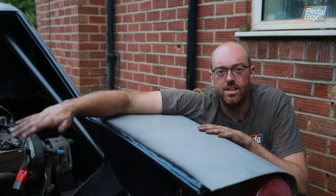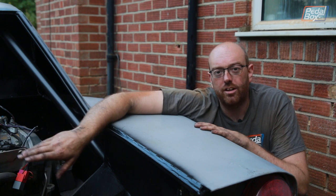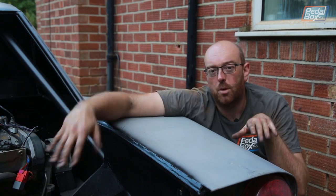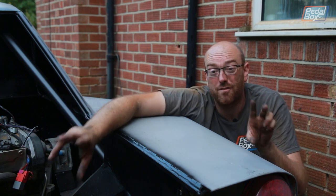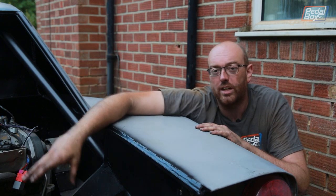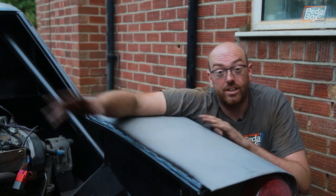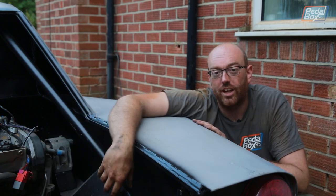The centre section of the exhaust with the cat in isn't going back on this time, we're just going to put the box back in because that's going to be going off to get welded soon enough. But I've also got a heat shield that I've made which goes between the two chassis legs across the top of the box and the cat in the exhaust, because we've got two big fans that sit on that intercooler in the back and that's going to draw a huge amount of air through. We don't want to be cooling the catalytic converter - we want that to stay nice and warm and efficient, but the intercooler on the back obviously needs some airflow through it.